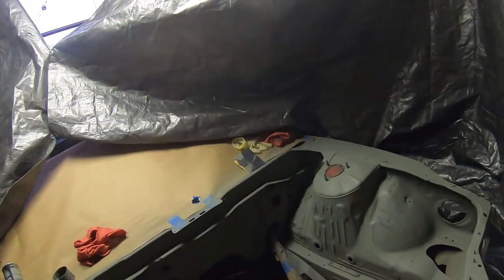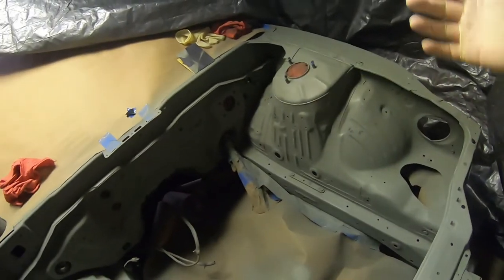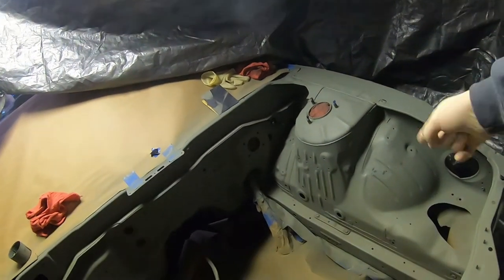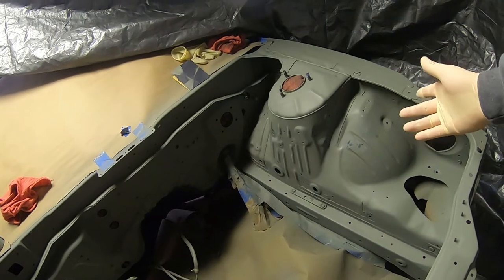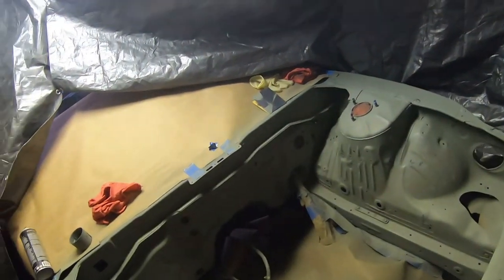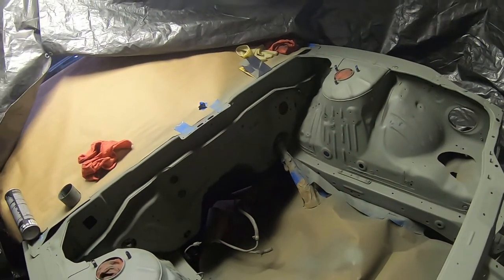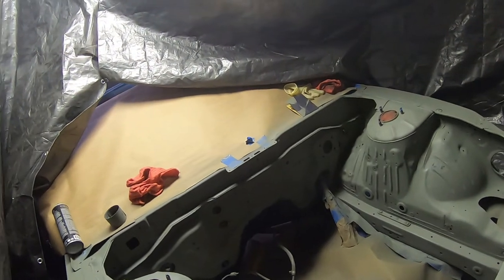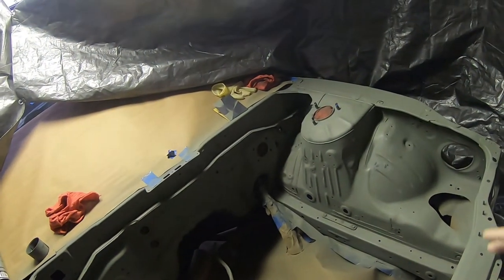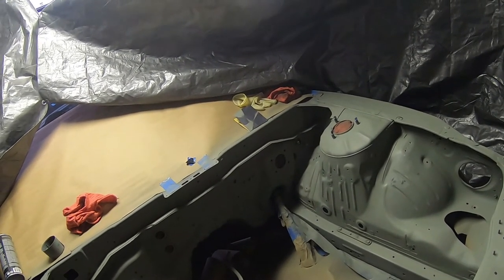There are little dust particles I keep seeing. I had to sand down one area - once you paint it all one color you kind of see more little imperfections. I found a couple of high spots, I don't know if it was sticker residue or what, but I sanded that down and got it pretty level. The primer looks pretty decent overall. I'm going to go over the whole engine bay one more time with a rag, triple-check everything, and then I'm good to go for the high-build primer.